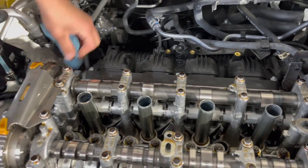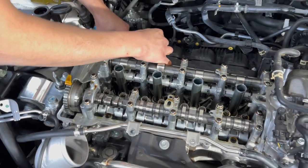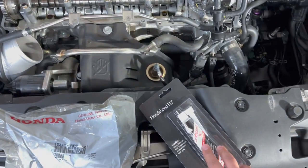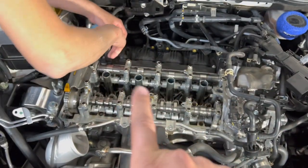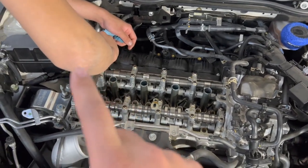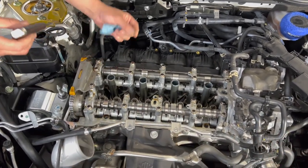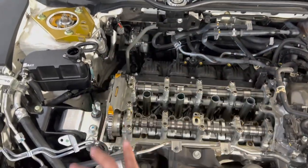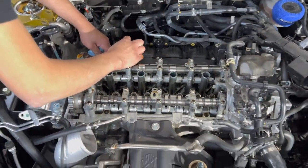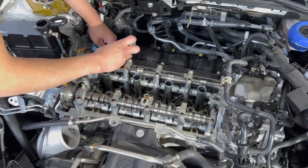We are also going to, like he said, prep it with alcohol after, so we have a nice clean adherence with the HondaBond. And like we said, we took the extra time to remove everything for that specific reason, so we can get in there, remove the HondaBond nice and cleanly, and have a nice clean surface. Otherwise you'd have all this crap around you while you're trying to fit your hands in there. Again, it's all in the prep work, boys. It might take long, but trust the process. That way you have extra elbow room.